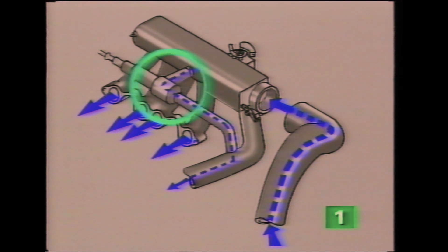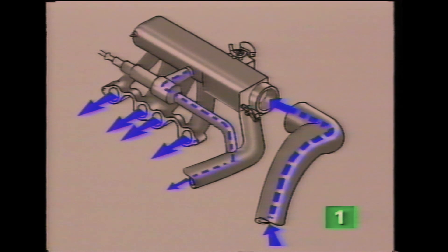At the correct moment, the idle stabilization valve is opened. This allows unwanted air to be directed back from the manifold to the inlet side of the supercharger, thereby reducing the boost pressure. In this way, it's possible to control smoothly and accurately the boost pressure.